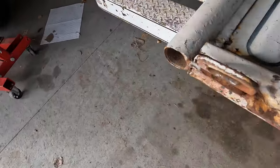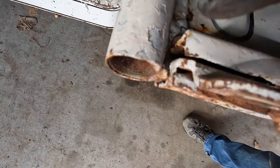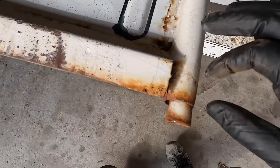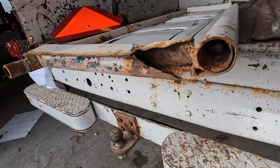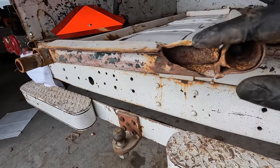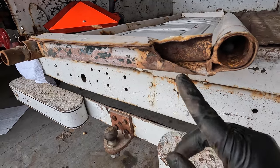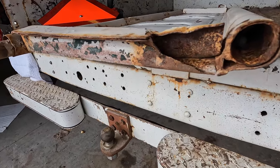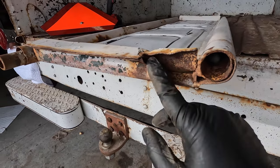Here's the good side. It's kind of a strange design. This right there is part of the tailgate, and there's an opening that runs down the whole thing — a cavity up in there. Inside that cavity they slipped this little bracket and it looks like they welded it on somehow on the inside. Clearly that was done at the factory. On the bad side, you can see the cavity that runs down the whole side. That bracket was welded to a piece of the tailgate that's now missing. I guess I need to cut off this jagged piece at a 90-degree angle so it's something we can actually work with. Let me go see what kind of metal I have in stock and I'll go from there.